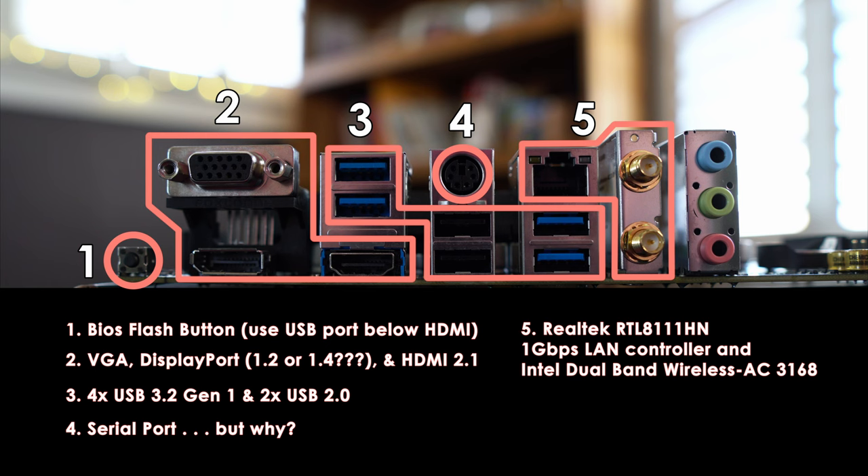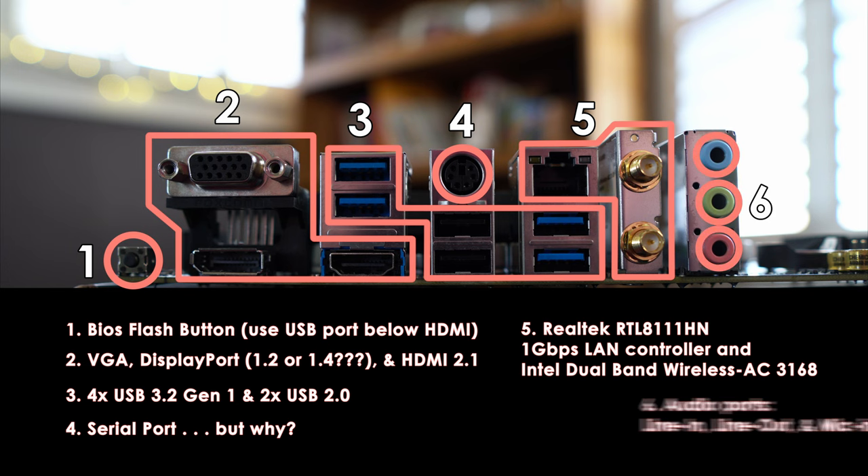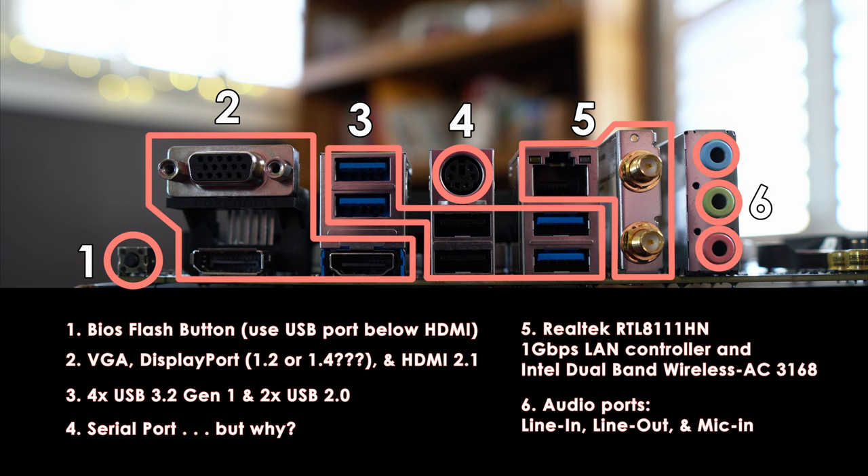Finally, there's the rear audio. The Pro VDH uses the Realtek ALC892/ALC897 codec. There are three outputs on the back: a line-in, a line-out, and a mic-in — you'll plug your headphones into the line-out jack. You can set up a 7.1 surround sound audio solution using this motherboard, but it will take some doing. You'll need to install the Realtek audio console software and plug various audio jacks into the rear and front audio ports. This is really an inelegant solution, and I think investing in a good PCIe sound card or an external audio solution would be your best bet. I really wish MSI would have just put all five jacks on the back.